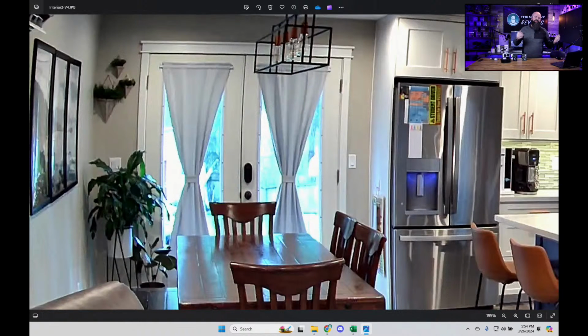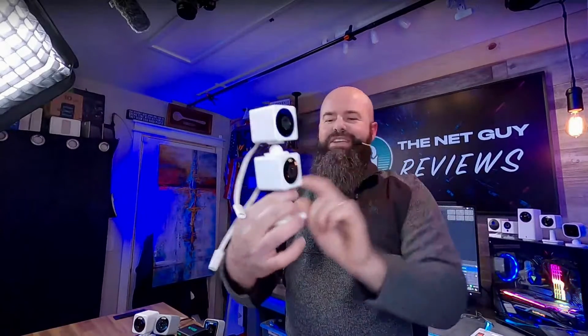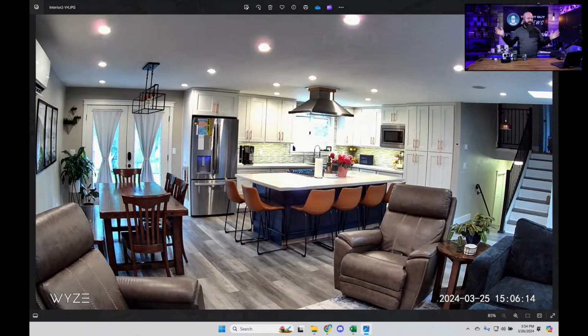Now, other people are gonna be like, well, I want that 160. I want that 180 field of view with the floodlight. Now, remember something about optics and cameras. The wider your field of view, the less detail you're going to get in the images. So if you narrow the field of view, if we're to pick on the OG series, this is the Wyze Cam OG. I'm going to bring you guys back here for a second. So this is the OG stacker kit. We've got the original, and then we got the telephoto up here. That telephoto is like a 23-degree field of view. It's super narrow, but it can stretch out and bring that image towards you. You get a whole bunch more detail. So when I say that the V4 has a narrower field of view, it just means that you're not going to get as wide. And to some people, this is going to be a deal breaker. You're not going to get as wide of an angle on the shot.